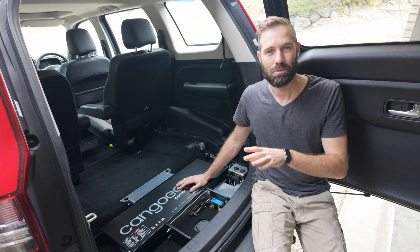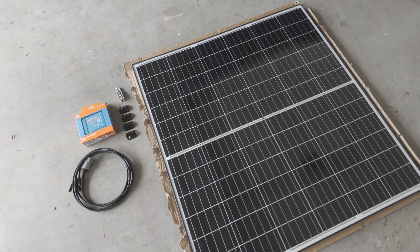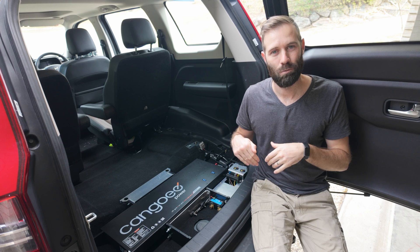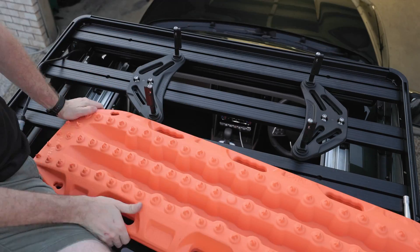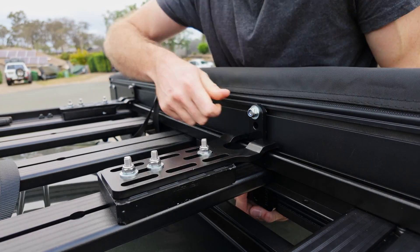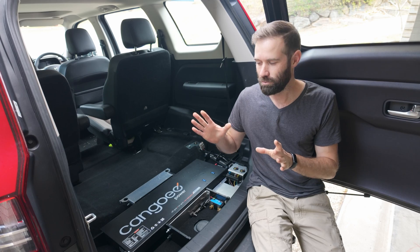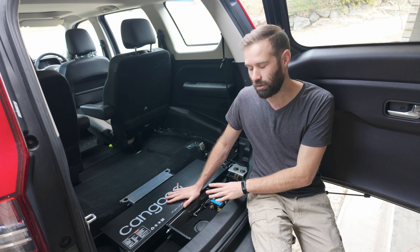Today's episode is about installing solar on the roof. The products I've purchased are a Voltec 200 watt solar panel — it's actually a metre by metre with a black frame. I went with that brand mainly because of the size; I wanted something around 200 watts to get as much power as possible into the car while it's sitting in the sun. I've already got a MaxTrax and 270-degree awning brackets taking up roof space, so that approximate metre by metre panel will fit up there perfectly. The other thing I got from Ken Goey is a Victron MPPT 75/15 smart solar controller, because solar panels come in at a higher voltage than the battery can handle, so a controller is needed to regulate that down to a charge the battery can accept.